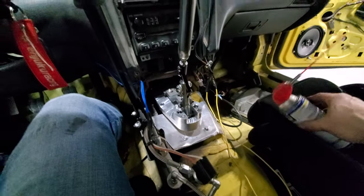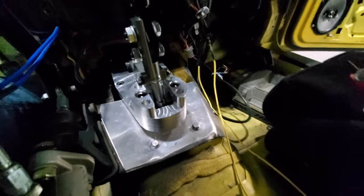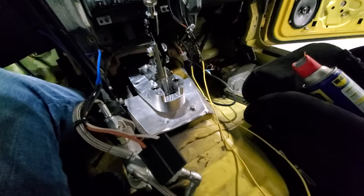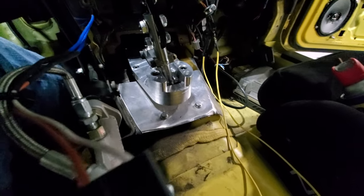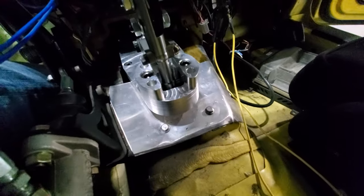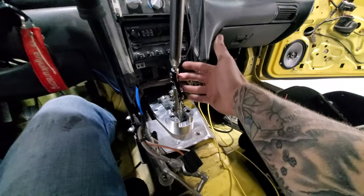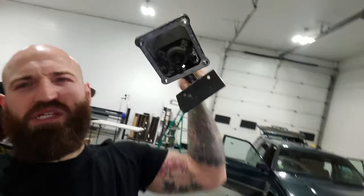As far as the noise goes, a bit of WD-40 sprayed on the spring seems to have addressed that. However, even with tightening the bolts the springs are still on the softer side, and if you crank them down too much you lose the ability to go into different gears. I guess this loosey-goosey shifter feel is what we're going to have to go with — it's really not that big a deal. We'll live with it and maybe focus on doing something with this elbow. Overall I actually do really like the shifter — it looks really cool — and I get to throw this hack job away.